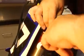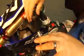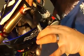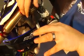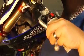And there you have it, this thing. Put it back together. Now you got some good slop in there. So give yourself a little bit of play. Very important adjusting. Don't take all the play out of the clutch, and don't leave too little play. I like a little 1/4 inch is good or so. That's about right. Ooh, feels buttery smooth, I gotta say.